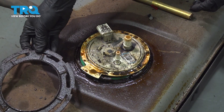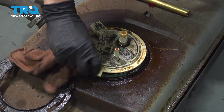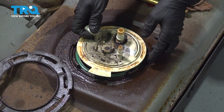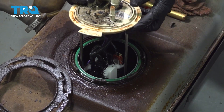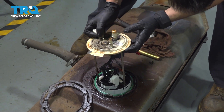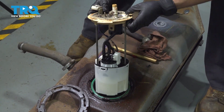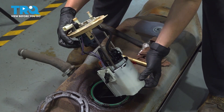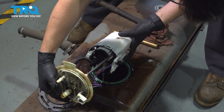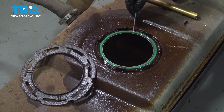There it is — take this off and set it aside. At this point I have some debris here; I'm going to gently wipe it off with a rag so it doesn't fall into the fuel tank and contaminate the fuel. Remove the fuel pump by pulling it straight up — careful of the rest of it. Try to drain as much of the fuel from the pump back into the tank. The level indicator float is right there. Remove the O-ring that seals up the pump.